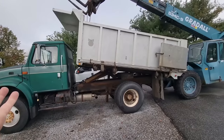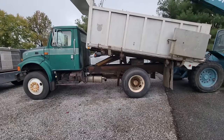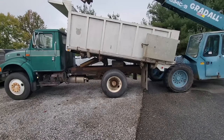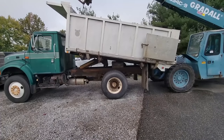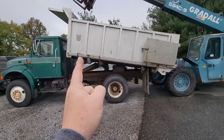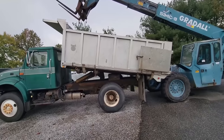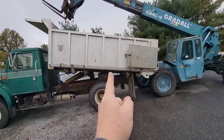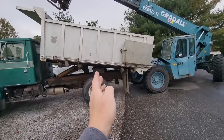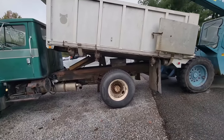I bought the truck, I looked at it, and there's a lot wrong with this truck. The fundamental setup is just really bad. If you look — I'm going to get straight on with that axle right here. You can see we have more behind the axle than we do in front. That's never the way you want a dump bed set up, for sure, if you're hauling any weight to capacity. This is just too much weight here. You lift off the front steers. It's just not a good combination.